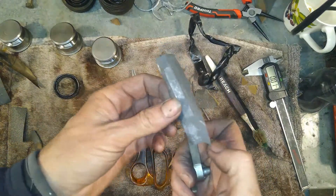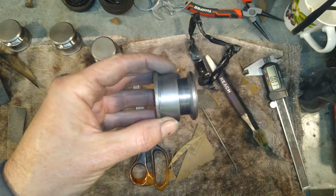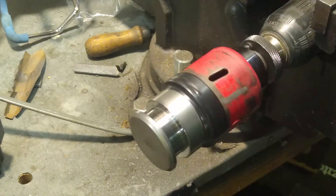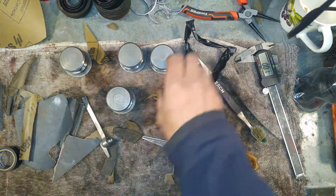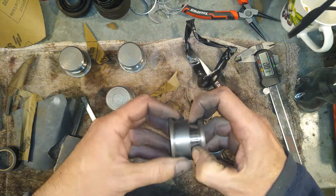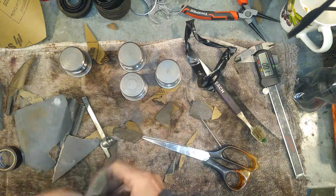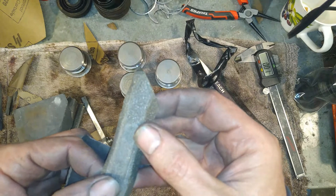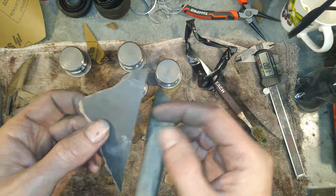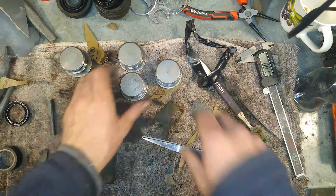I've got a piece of flat metal and varying grades of emery paper. I don't have a lathe to clamp this in and spin it up, but I've put the piston at the end of a power drill and away I go. That's worked well. I've dressed the sealing surface on all four pistons so they've got a nice smooth surface now. I used silicon carbide paper — started with roughly 120 grit, then moved to a slightly finer grade, and finished with polishing at around 1000 grit.